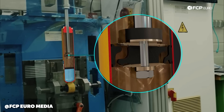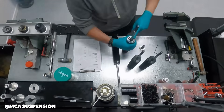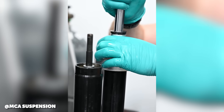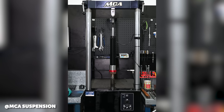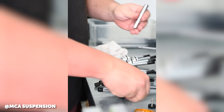In the development stage, having a bigger amount of shims gives you more tunability — you can make smaller steps. By having more shims in the stack, you've created more points that you can change. If you've only got 6 shims you can only affect it 6 different ways, but by having 20 shims it opens up a world of possibilities.